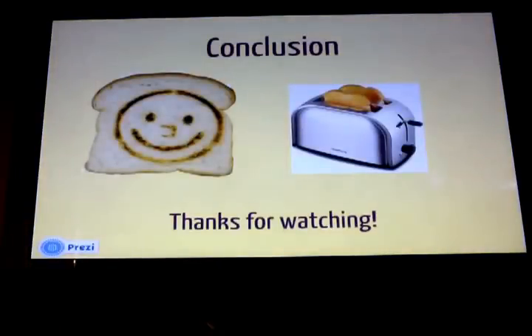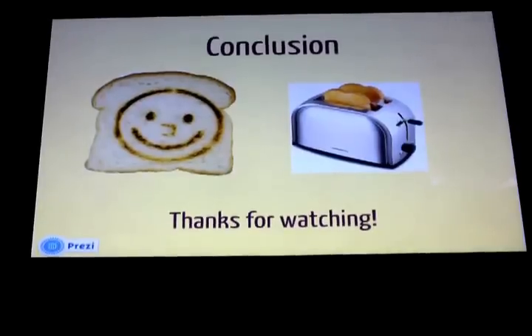In conclusion, our presentation was on the toaster. To recap, we focused on two big questions: how does a toaster heat, and what are the various mechanisms a toaster uses? A toaster heats food using infrared radiation. Nichrome wire wrapped around a mica sheet is the source of the infrared radiation. The toaster also has a spring-loaded tray in which a metal holder moves up and down to raise and lower the food. The holder is connected to a handle that you press on the outside of the toaster. When the handle is pressed down, there needs to be a mechanism to keep it pressed down for a certain amount of time. Additionally, the wires need to begin heating and a timer needs to be activated. When the handle is pressed down, it activates a circuit board which acts as the timer. We hope you all know a little bit more about the toaster today after our presentation. Thanks for watching!